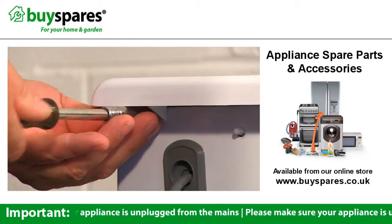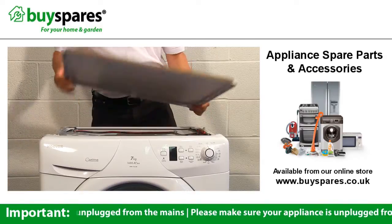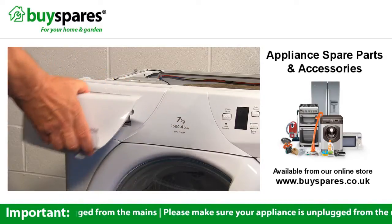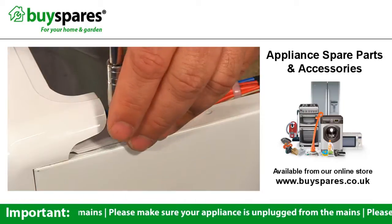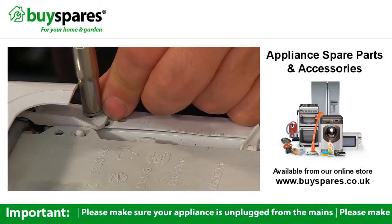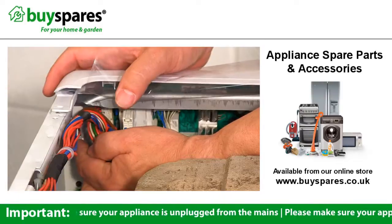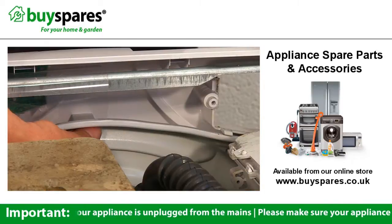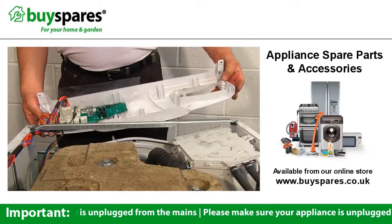Remove the top panel and slide it back before lifting it off. Remove the soap drawer and the screws holding the front panel. The soap dispenser housing is now free to be pushed back. Unclip and release the control panel by pressing on these tabs. Then lift off the front panel.